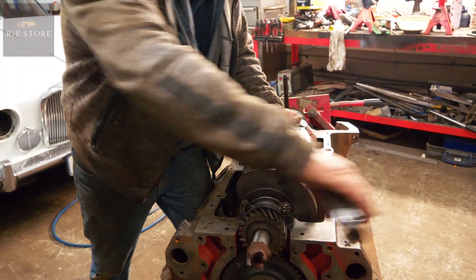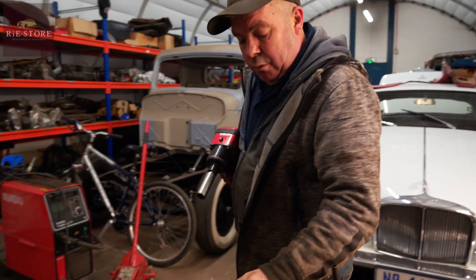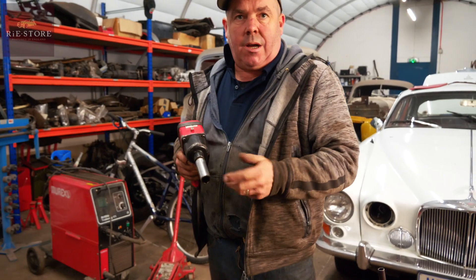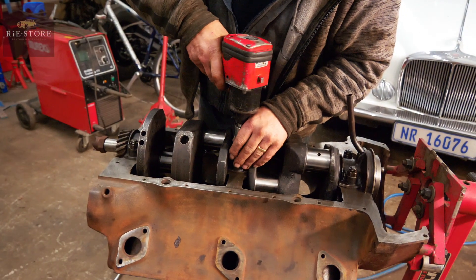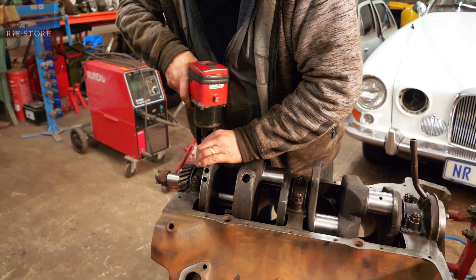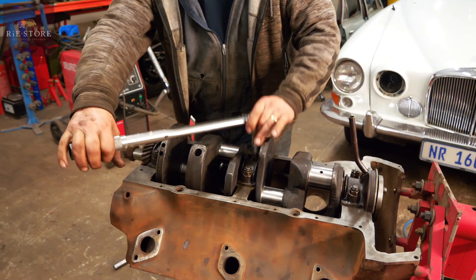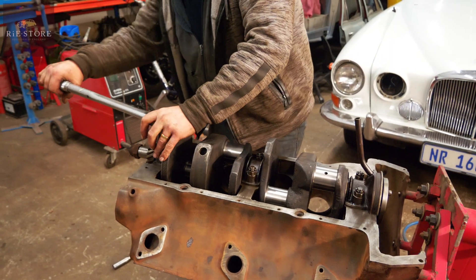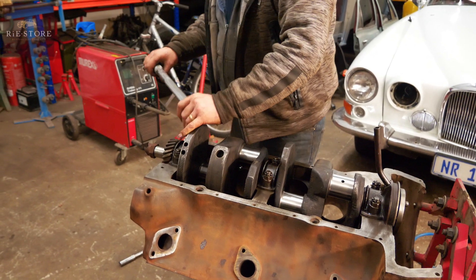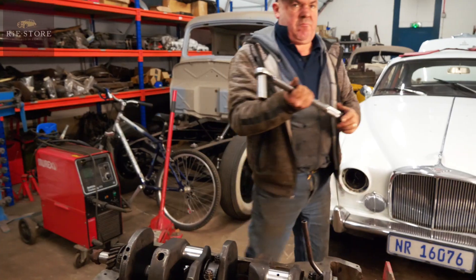It'll all be turning now, it'll be a pain. When you say it's turning, what does that mean? Well the whole bolt is turning. If you put the air gun on it, that shock will just lock it in. Just to lock it once. Wouldn't there be a danger of over-tightening with the air gun? No, if you just buzz it quickly. I know they're 100 foot-pounds - that's quite a lot.